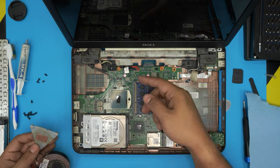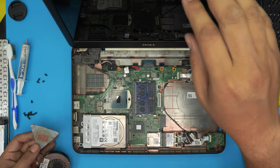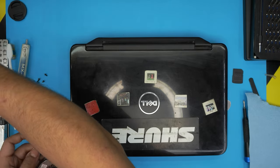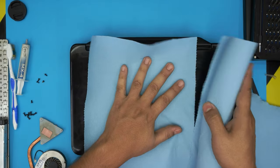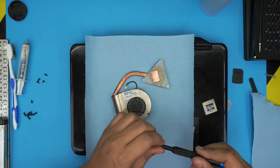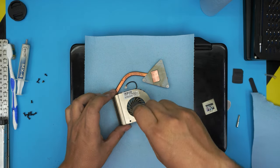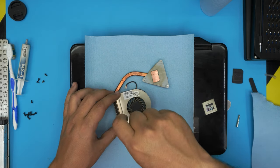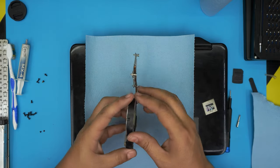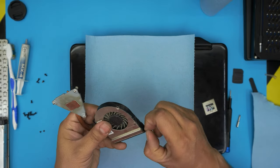You can take the fan outside with compressed air or a vacuum to clean it up, and use a toothbrush to clean up the whole thing. I'm going to lift it to one side, put a workshop towel in here, service up the fan, and lubricate it. We're going to remove the two screws right here — these are Phillips double zero. Go ahead and remove this screw.